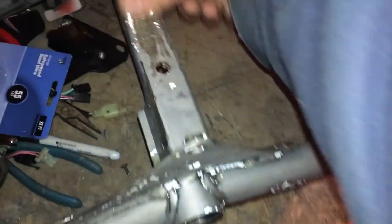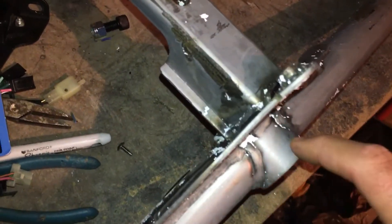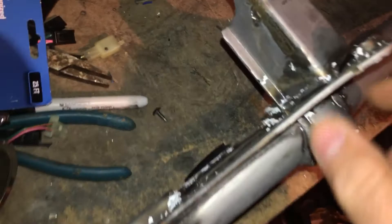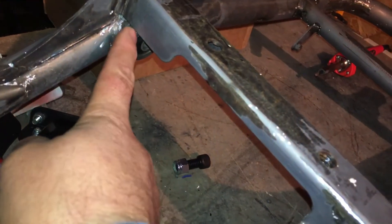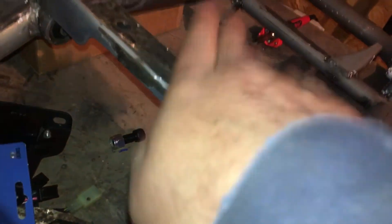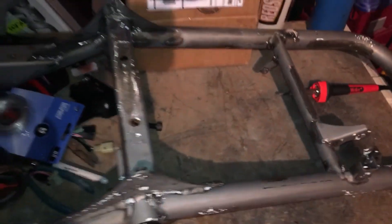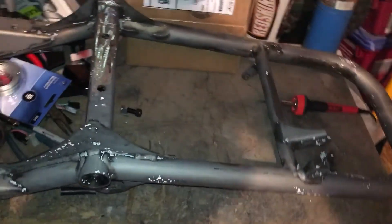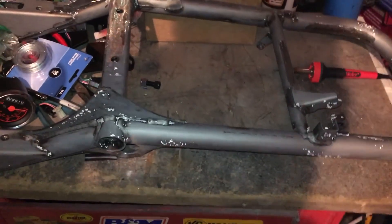The rear sets are going to be welded onto that. This square section is going to be taken out — it's a one and a half inch outer diameter tube — and I'm going to weld it from here over to here so it looks like a continuous piece going across without the square piece. That's the plan for that. I just wanted to make a short video since some guys have been asking — so there it is.